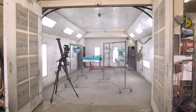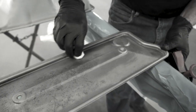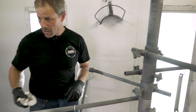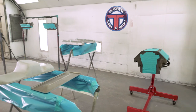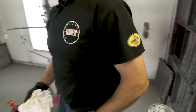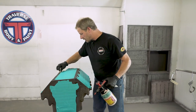After a good amount of time, our engine block is clean and all our other parts are clean. We're finished with a wipe down. You want to do a little degreaser on everything before it gets sprayed. These are alternator brackets and other miscellaneous pieces — everything's masked off. Block, heads, valley pan, crossover, timing cover. I'm wiping these down last minute with wax and grease remover just to make sure oils from our hands don't cause any adhesion issues.